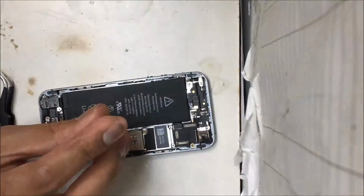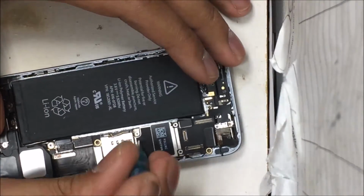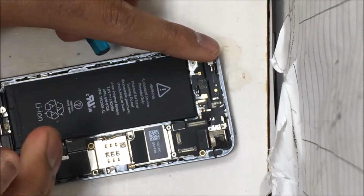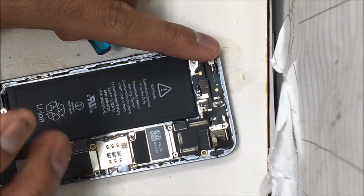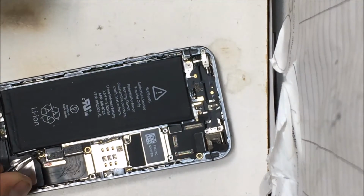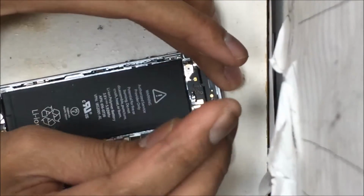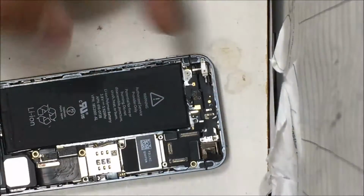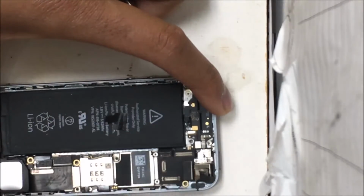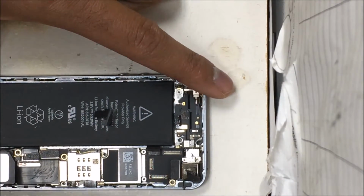So you will proceed to it. We're going to loosen up the motherboard. You're going to take the battery cable out, the USB connector cable, and that's the power switch cable. You're going to carefully unclip the wires and remove all the screws before you pull out the motherboard.